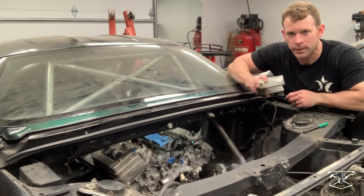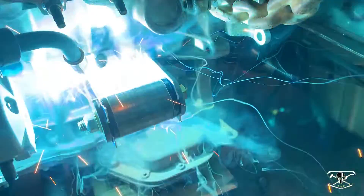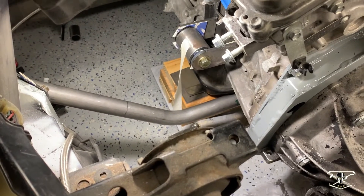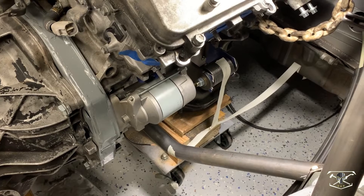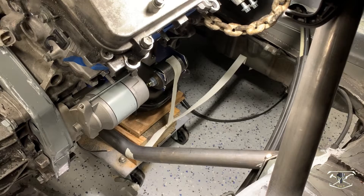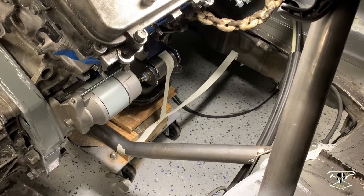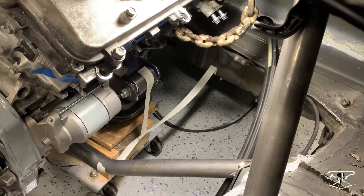Now that I have that crossmember tack welded into place, I'm going to come back in with these motor mounts and tack weld those to the base plates I made on the motor. That motor mount is welded in and fitting great. That tape just represents how it can drop straight down to that crossmember with another piece of tube. However, on the passenger side you can see the motor mounts are not symmetrical the way the block was made — this one sits further toward the center of the car, so when I drop it down it won't touch that crossmember. I'm going to have to make a J-frame with a tube running from that crossmember to the actual unibody, drop down a piece of tube to connect, make some gussets, and we'll call it good.